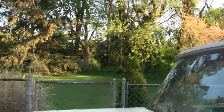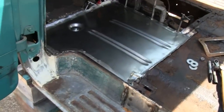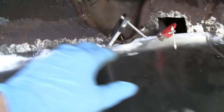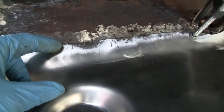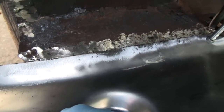It's the next day and I got the floor pan in here, clamped in place exactly where it's going to go. I marked up exactly where I want to trim it — I just need to take maybe a sixteenth of an inch off so I can weld it in place. All this stuff is fitting good. It's funny — these rot holes I had to cut out are actually benefiting me because I can clamp the panel in place. There's a steering column hole here too, but I'm able to run my hacksaw right along the edge and then butt weld it up.